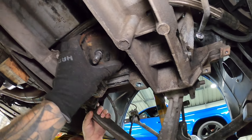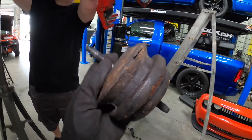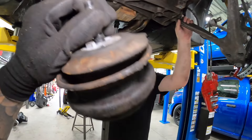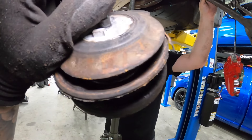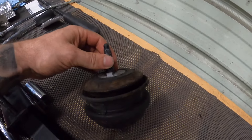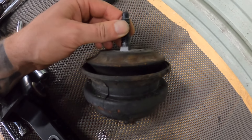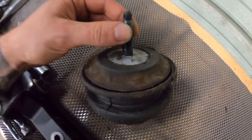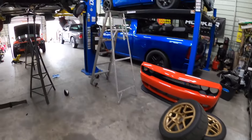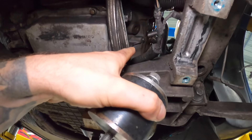This thing is in two pieces! I'm going to manipulate it through here — make sure you go around this wire. Look at this — it is in two pieces, complete separation! It's almost about to fully come apart. It needed to be changed — that is insane, literally polished on both sides from rubbing. Going to go ahead and put our Hinson mount in — it's a lot smaller to navigate through here.